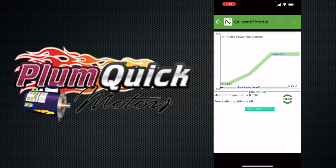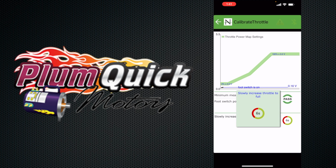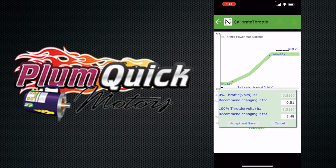Now we're gonna press the accelerator pedal all the way down and just hold it for 10 seconds. We can go ahead and let off now. It shows you your 0% throttle volts. It shows you it recommends changing it to 0.51. It shows 100% throttle volts is 3.51. It says recommend changing it to 3.48. So we're gonna go ahead and accept and save. Let it save and do its thing.